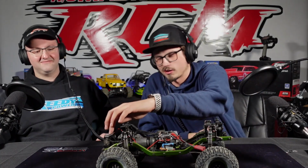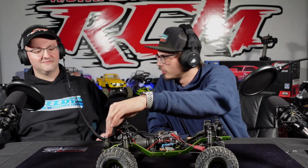And I do run the fan on it because I run that at 8.5 volts right from my Castle BEC. I can't remember the exact specs, so don't yell at me too much here. But I think the 92 is in the 700 ounce torque range at 8.5 volts. That's like 3 normal servos. Yeah, it's 7 something. And then they make the 2090, which is the higher torque one, which I think is just under 1,000 ounces of torque. 900 and some change at 8.5 volts.